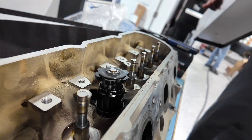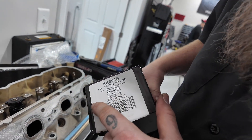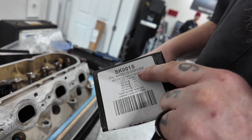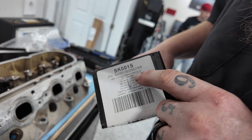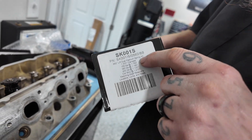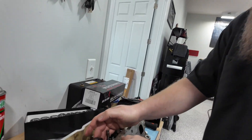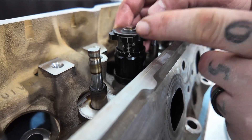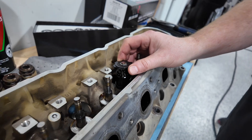What's cool about our packaging and the label we use — your install height is 1.780". So this is your coil-bind numbers, open, close, and so on. Install height of 1.780" is what you want on our 660 springs. We've basically set this tool up to where the spring is going to be installed, and it is 1.780" on the dot, which is pretty nice.